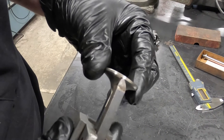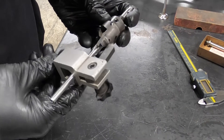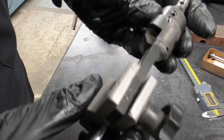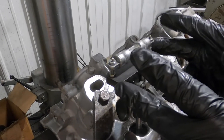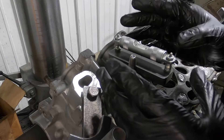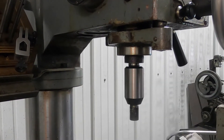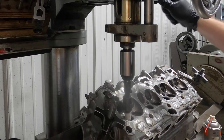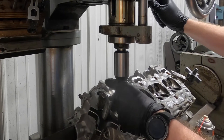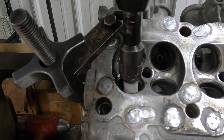Here I'm setting the tooling up for the valve job. This is what shows you where the seat is supposed to be on the valve, and then you would lay that same pointer — without changing it — over to the actual seat cutter. We're going into leveling the cylinder head here now. You've got to level each guide individually when you cut the seat in both directions. I want you to listen to how you hear it clean up — you'll hear it cut, it'll sound like it's not level, and then it'll clean up eventually. That's pretty typical of how the valve job goes.